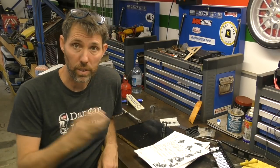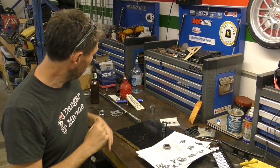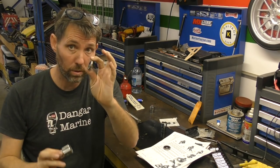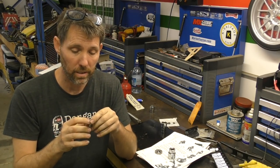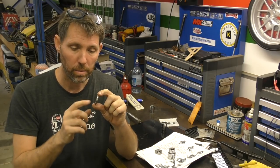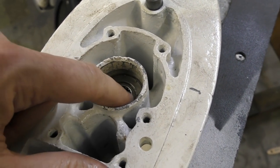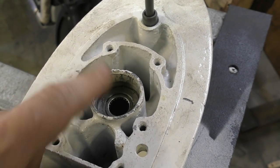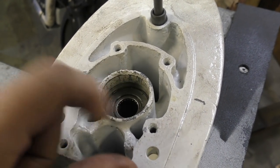Now I'm going to put the drive shaft oil seals in. They go in the same way — back to back like the prop shaft — only they're vertical. I figured out a one inch socket was a pretty good size for these: close to diameter but slightly smaller than the seal so it won't score the housing. The surface they come up against is clean, so I'm just going to put them in as-is, but once again I'll oil the inner lip so when the drive shaft goes in they don't get damaged. If you find you've got gearbox oil in your cooling water, it's because these seals have failed and the water pump is sucking it up.